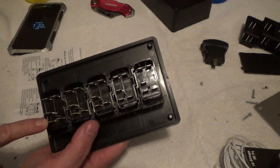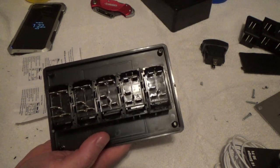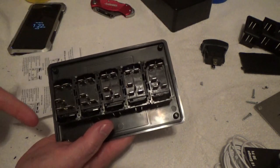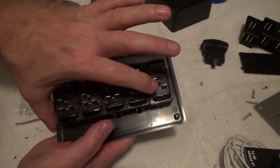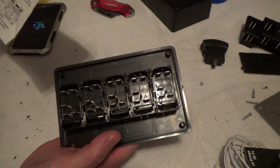But most relay LED bars don't even pull that much power, but I've got something else I'm adding in along with the relays that you guys will see later on down the road. So anyway, number 3s will power or trigger your accessories, or trigger your relays, one of the two. Those will each have their own individual wire going out to your relay pack or to your accessory. Now, the next one's gonna be number 6.